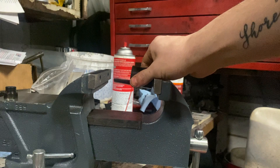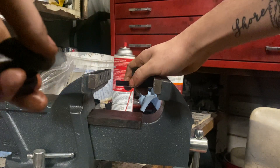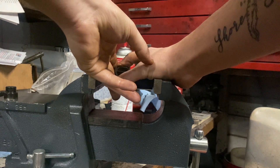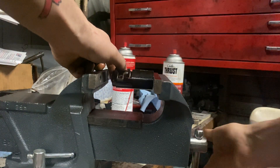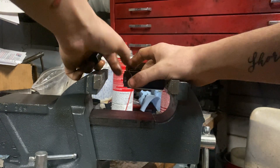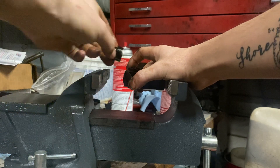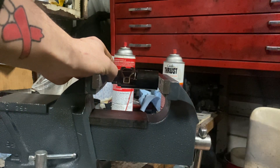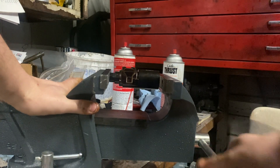Here's a stock rocker and the Comp Cams tool — I'll leave a link in the description. The vise isn't bolted down, so I'll show you how easy this is. You take the flared insert out — it's magnetic so it comes right out — back it out so the countersunk piece fits in there, make sure it's sitting flush, then start cranking it down. You'll feel it bottom out and watch it start to push the trunnion out of the rocker.